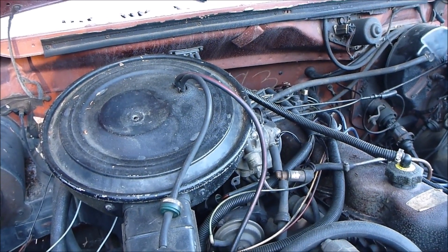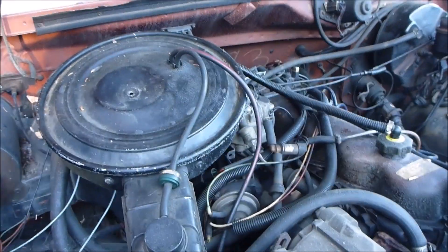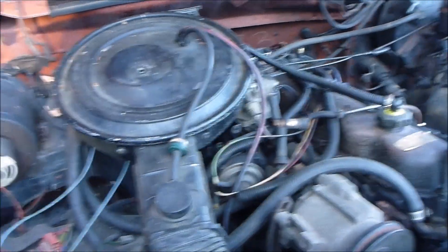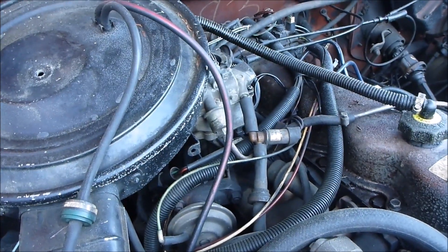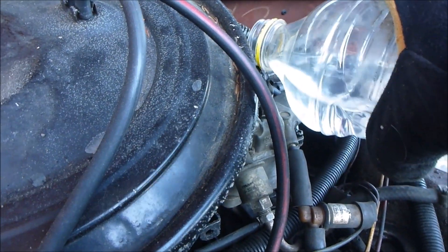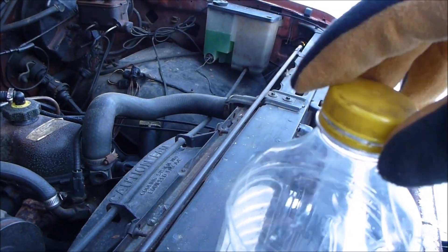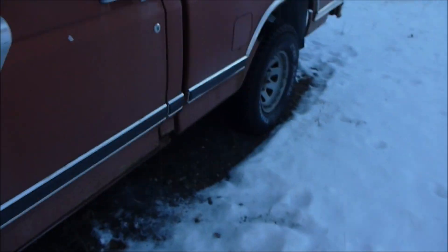More times than not, when you're messing with old stuff like this, you usually have to compensate with something because either something doesn't work or something doesn't work. So in this truck's case, you have to compensate for its accelerator pump all winter long every time you go to start it. So this is how I do that — just get some of this in there. Put the cap back on because this stuff ain't free. Don't worry about the air cleaner — the snow will clean out the carburetor nice.